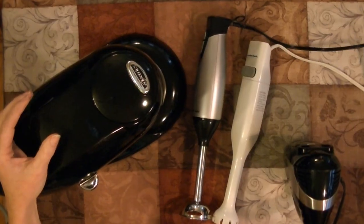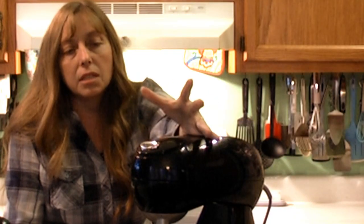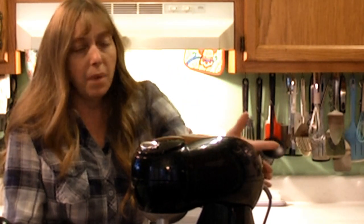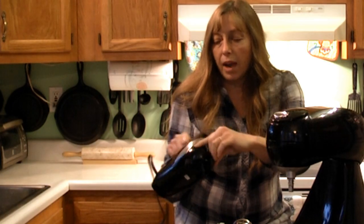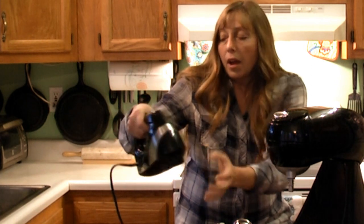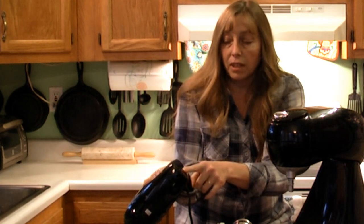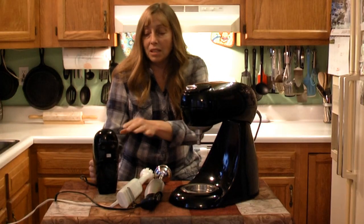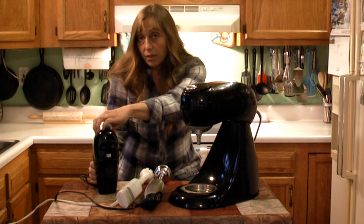Also a big thing that affects heat buildup in electric motors is the air intake and exhaust. On this one, the intake is up here under this plate and it's kind of protected, though it does still tend to get a little dust from whatever I'm mixing. The exhaust is back here. On this cheaper mixer, the intake is right here over where the beaters go, so whenever I mix anything it sucks it right up in there and exhausts it back here. Whatever I'm mixing you can see it on the exhaust — everything I'm mixing is going into my motor.